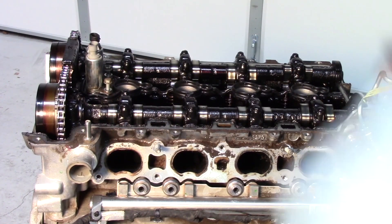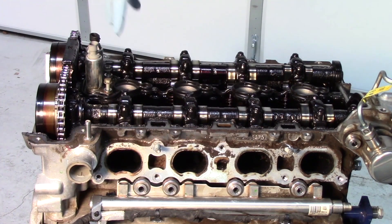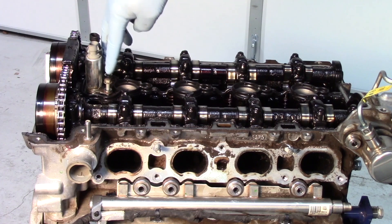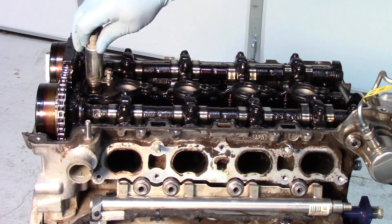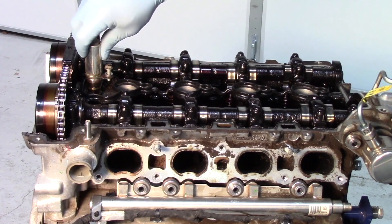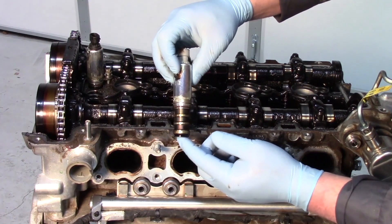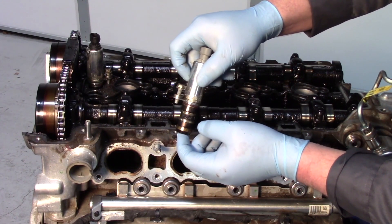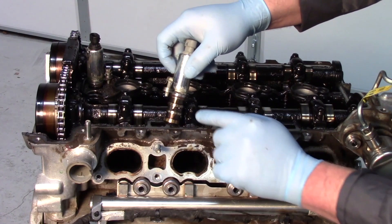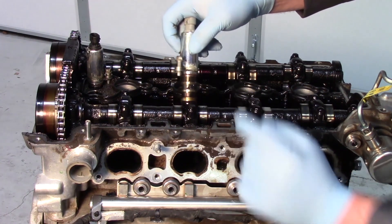The control of that is done through these two different solenoids. With the valve cover on there's a little opening, so the technician can unbolt two bolts and remove these solenoids. I do a little bit of prying and pulling to get these out. If you look at the screens in here they don't look too bad, except you'll notice some sludge — not a big surprise considering the state of health on this engine. That's a bad sign.